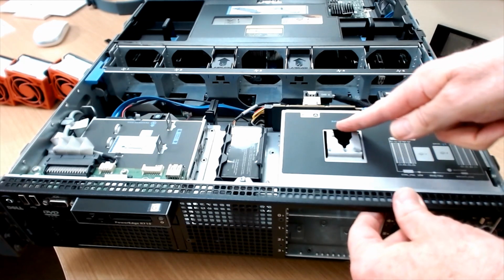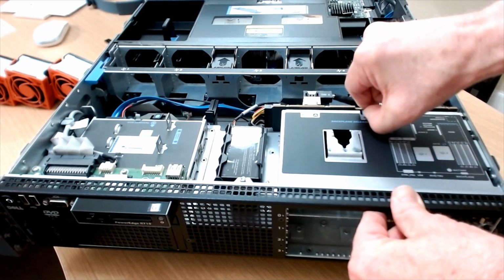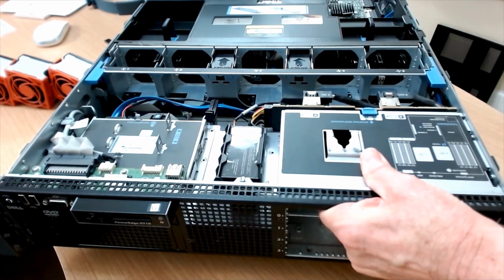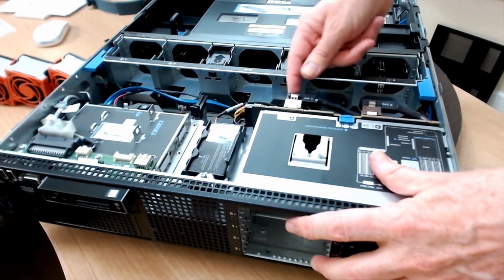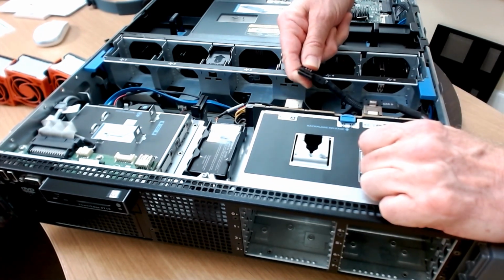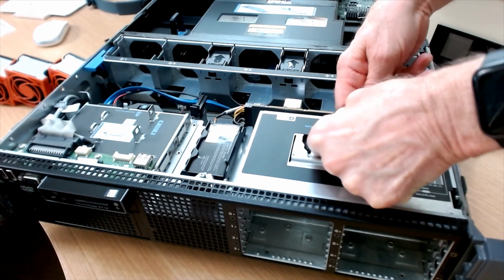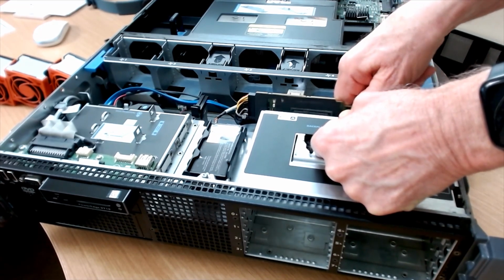Here's the drive bays. This right here says backplane release. There's a lever. I've never tried taking this one out, so it might take me a little bit of futzing around. Ah, that's what it does. There's these electrical connectors here, a lever to press down, disconnect. Here, press down on this blue lever, backplane will come up a little bit and then back, then comes out.